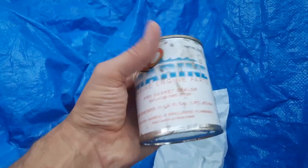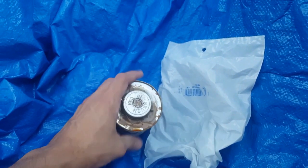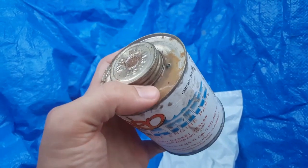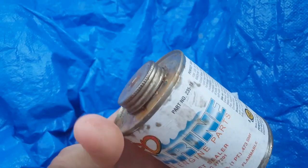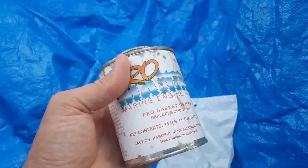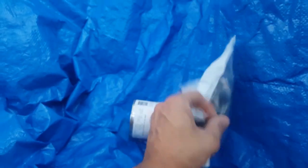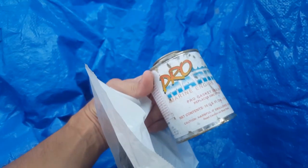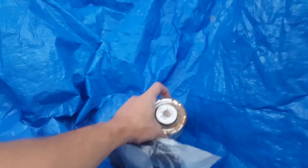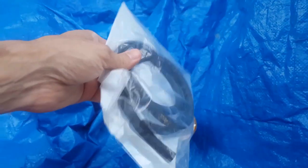The other piece you're going to need - it goes by a few different brands - is gasket sealing compound. I bought the bigger container. It has a brownish look to it and it rarely ever dries - even as I touch it here it's still tacky, and it remains tacky for the life of its application. You cannot install the transom seal without it. Get the one pint, 16-ounce size - get the bigger version, especially if you're doing a good amount of projects.